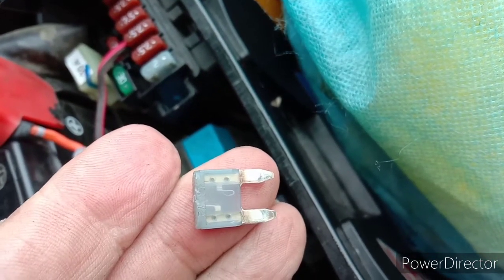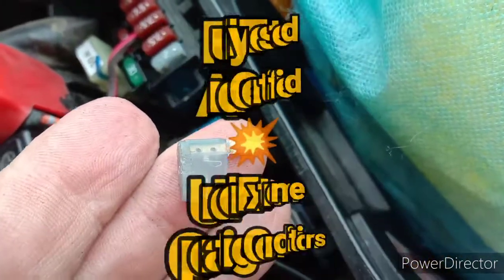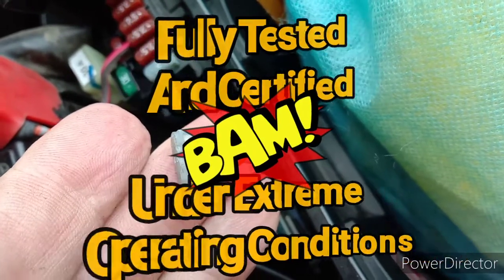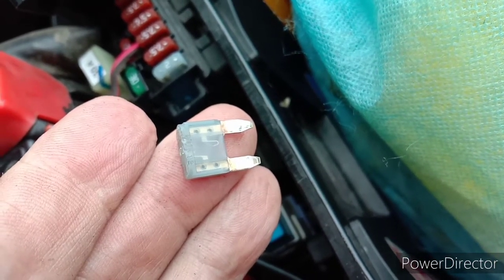While you're fooling around, make sure you turn off your ignition switch, because I blew out the original fuse — luckily it comes with a backup, but this one's toast. So make sure you either pull the fuse or keep the ignition off while you're playing around.